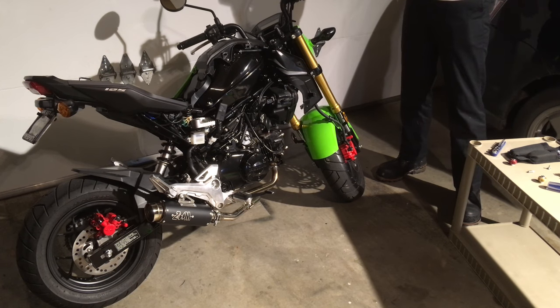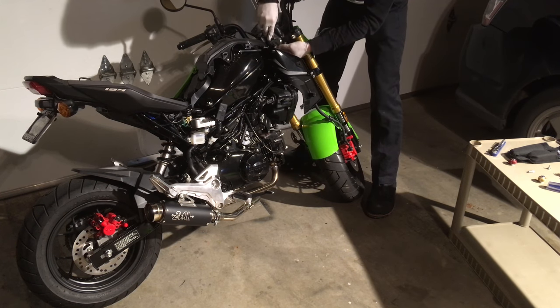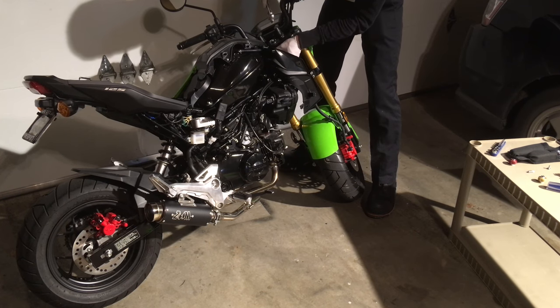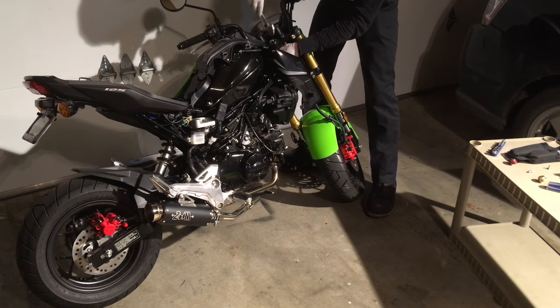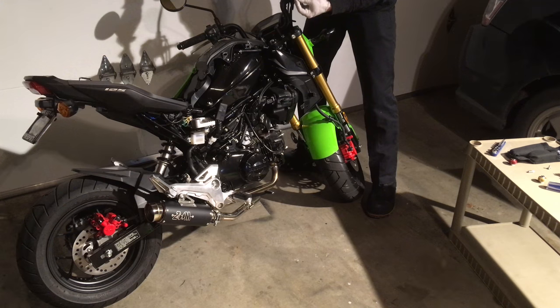I even take one more time. I'm going to take just the Phillips piece from a drill driver and a crescent wrench and see if I can wiggle that in place. There's just not a lot of clearance between the center of the triple clamp and this screw that holds down the gas tank cover. So I'm not sure. I'm sure there's a trick to that.